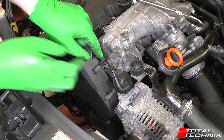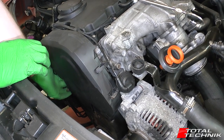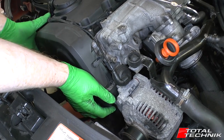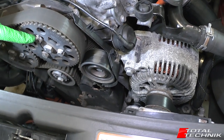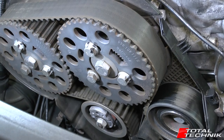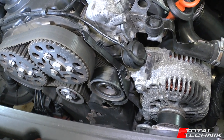Let's get the cam cover off. There are two clips on this side and one down the other side — get those removed and the whole thing lifts up and pops off. For the sharp-eyed among you, you may have spotted some crazy pen marks on here where they've obviously had some problems setting up or fine-tuning the timing — something we'll look at at the end of the video. This is exactly the sort of thing I mentioned earlier that we want to avoid with this job.